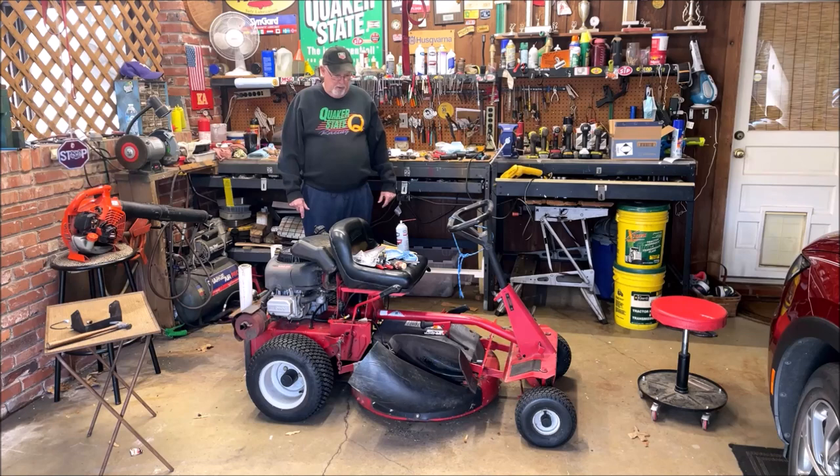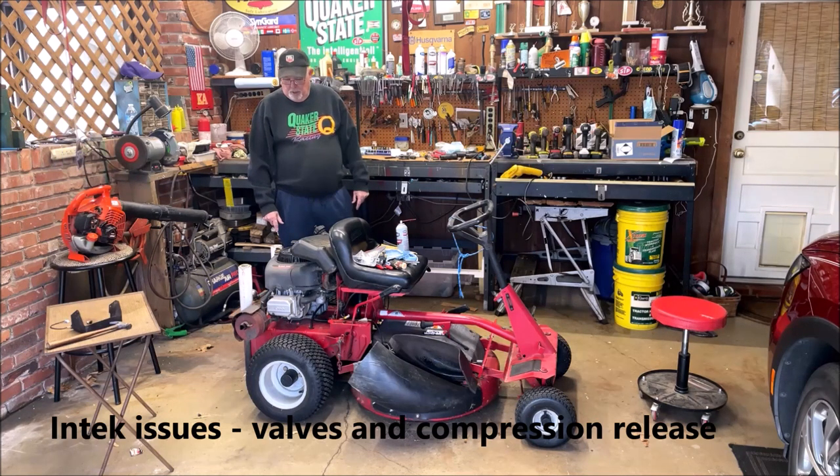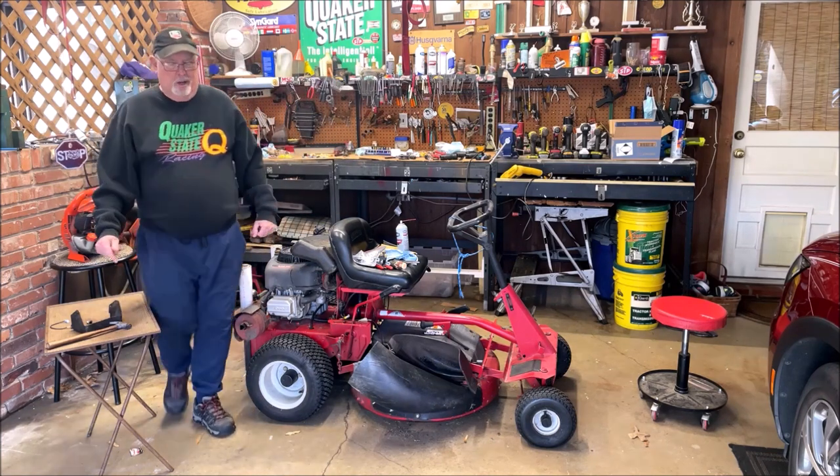I had cut my front and backyard with it. And CK called me the other day and said, "I'm gonna start. Did you put a starter on it?" "Yes, I can put a starter on it." "Can I bring it by?" "Yes, bring it by. I'll check it out. If it needs a starter, I'll get a starter and we'll put a starter on it." But with these Snapper mowers like this, there's all kinds of things that can go wrong with it. It could be a solenoid. It could be the compression release that it's broken and the motor's not going to turn over. So lots of possibilities. I told CK to bring it by and I'd check it out, and I'll show you what I found here. Let me bring you in a little better.